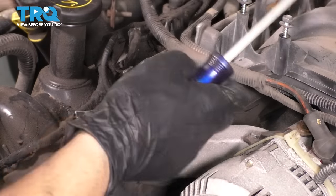Remove these electrical connectors over here. It leads to the back of the intake there. So I'm gonna grab a little screwdriver and very, very gently pry this hose off of here. Okay. Follow this, goes over there, over here, this red one. Okay, now we can very carefully move this out of the way. The hoses are very fragile, not the wires.